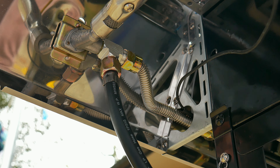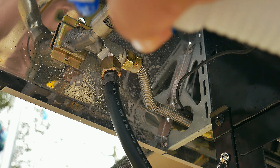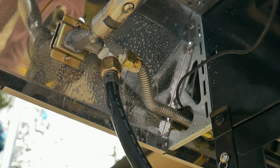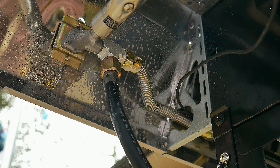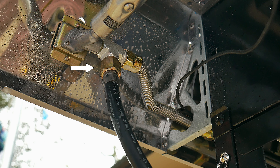We're going to follow the hose to the top of the grill and spray where the hose connects to the grill. Using the same technique, we're going to verify if any bubbles form. If you do have any bubbles, it could be the O-ring on the connector — you might just need to tighten the connector, or you may have to replace the entire hose and get a new one.